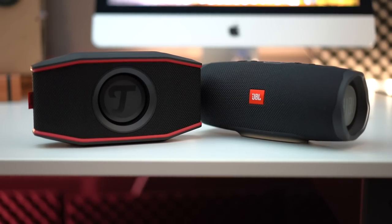Another issue with the Teufel is the positioning of the full-range drivers. They wanted more stereo, but it seems their stereo processing wasn't enough, so they placed two full-range drivers at an outward angle. This makes it sound weird — if you listen directly in the middle you get both channels balanced but it sounds a bit covered, while tilting it to the side gives you better treble. It's a questionable design approach. Anyway, if you enjoyed the video, leave a like or subscribe so you don't miss new uploads, and see you in the next one.